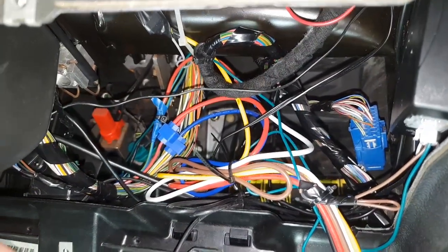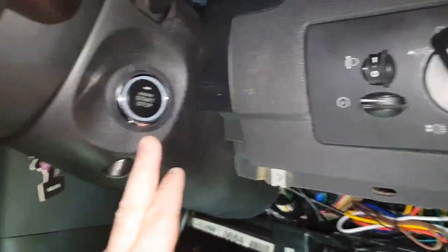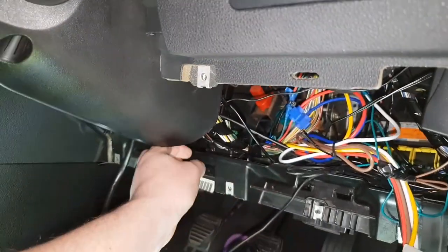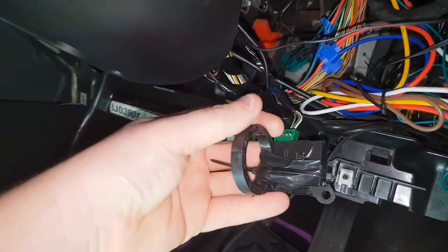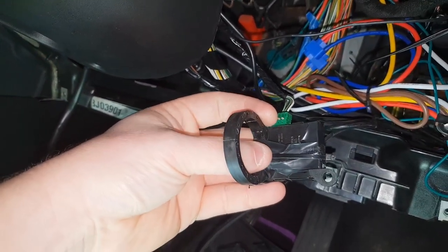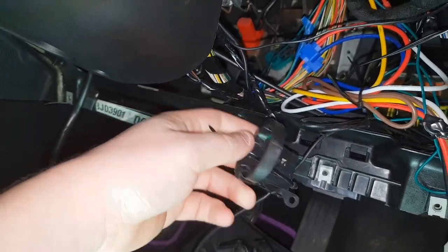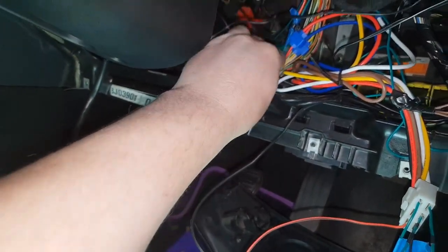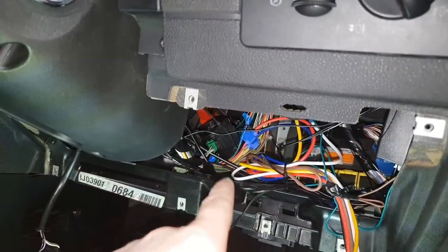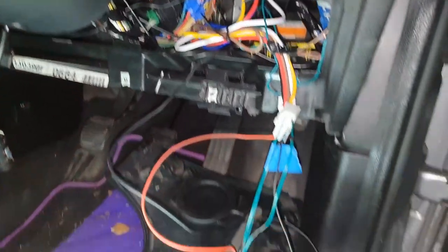To bypass the immobilizer — just for the purpose of this video I've pulled mine back down from where I hide it. What I've done is take the second key I have with the car, taken the chip out of it, attached it here and taped it all up. But you can buy the module for that — there will be a link in the description. You can leave that module hidden up around here, but you will have to sacrifice a key for this to work.